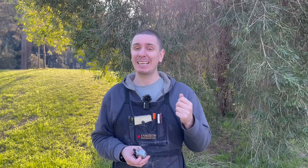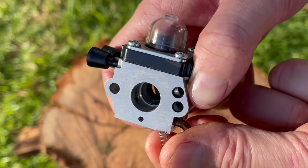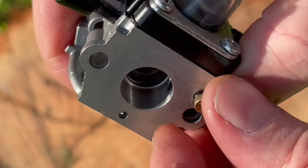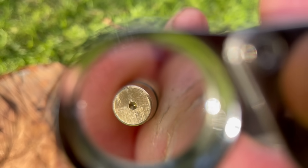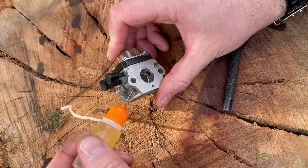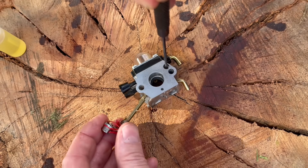To reinstall these parts, first add a little bit of oil to the groove on the piston and on the o-ring as well. Now install the small screen — a pick is really handy here to locate that screen correctly. The spring goes next, and then lastly that piston. Just make sure that if it looks the same on both sides, you orient it just how it came out — often there are wear marks that you can match up with either the throttle shaft or the spring.